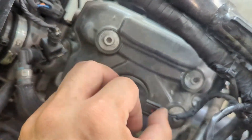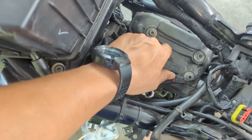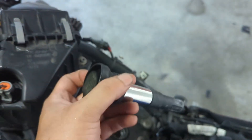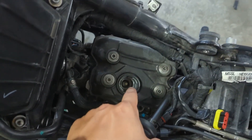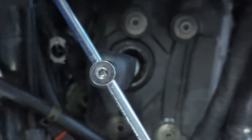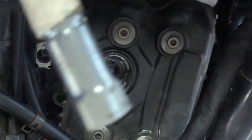To pull out the ignition coil cable, you need to lift up this part and then pull the cable out. We slowly feather the ignition coil out — it took a while, probably because it has never been taken out before, so it's pretty tough. We then try to extract the spark plug to check if it's in spec. The interesting part is that a normal spark plug socket cannot fit this spark plug — it's much, much smaller, so we have to figure out the correct size.